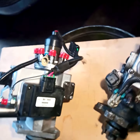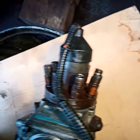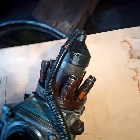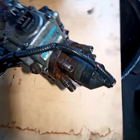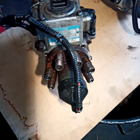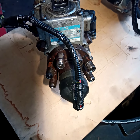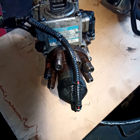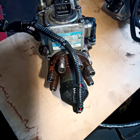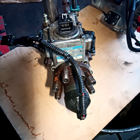There's a fuel solenoid driver in there, and I believe there's some kind of rotating unit that delivers fuel to each injector. It's not user-friendly — there's shimming and whatnot — so I never touched that. I figured if that's the only thing left we haven't touched, I'm just going to get a new pump, so I went online.